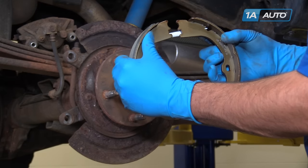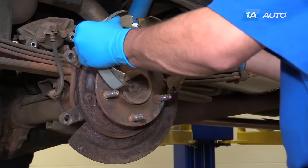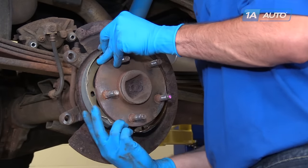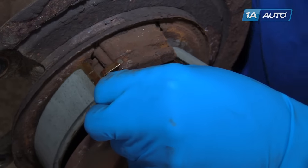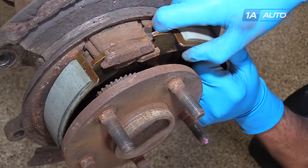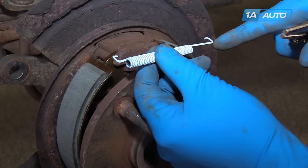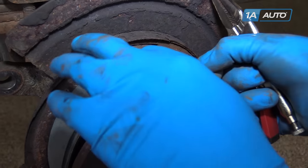From the front here, this spring sits on the rear. You're going to want the long end of the spring to sit forward toward the front of the truck. We're going to set our brake shoes over the hub and pry out and reinstall them onto the mechanism at the top. The spring that faces out toward us is going to go in the same way, with the longer part of the spring going toward the front of the truck. It sits into the same grooves as the one we've just installed in the rear.